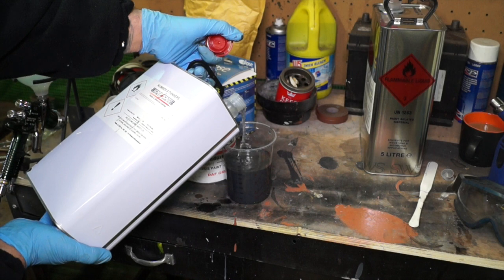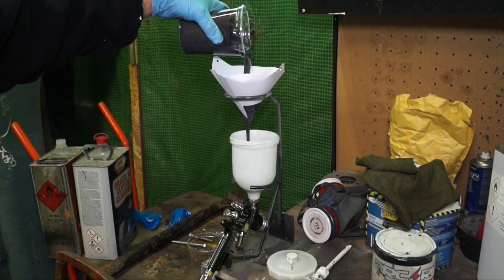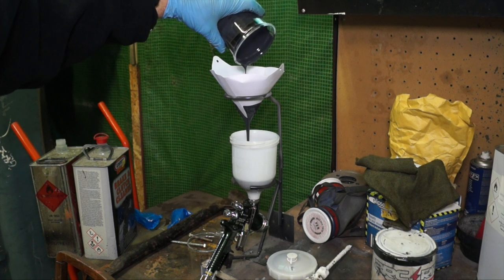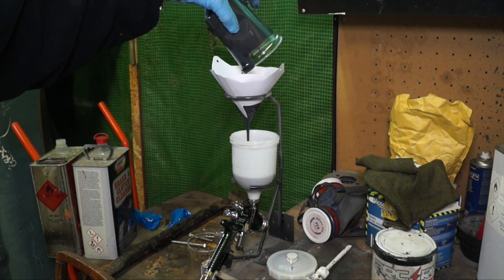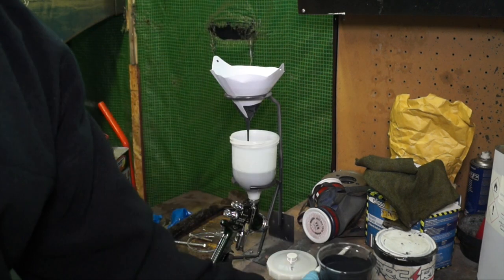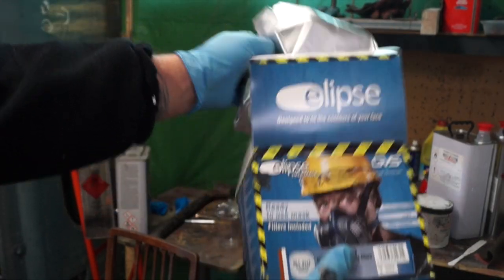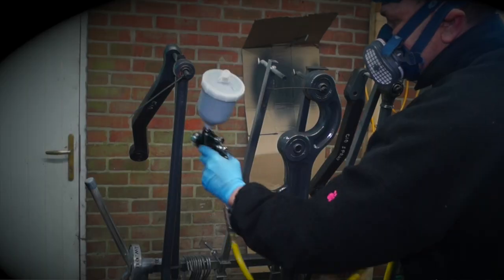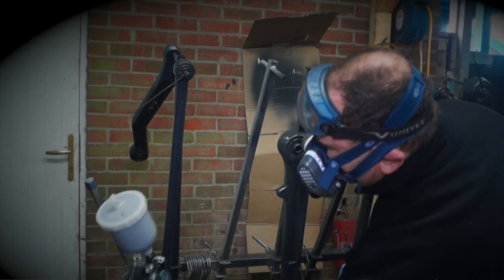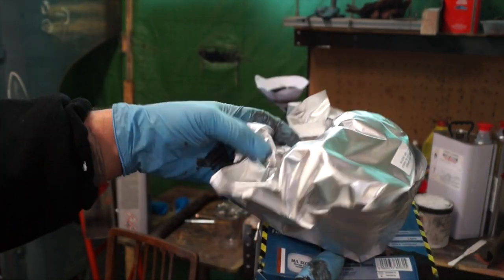Pour up to the marker and mix it really well. Spray painting is resource-wasteful because you're leaving paint in mixing pots — mixing pots are disposable unless you get washable ones, and filters are disposable too. If you're taking on a painting job, make sure you have enough paint — fill your whole pot to 600ml and it's less wasteful. The other important resource you need is a spray mask suitable for 1K paint. Don't paint without it; this stuff getting in your lungs is not nice.